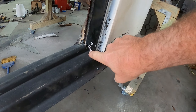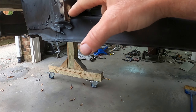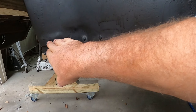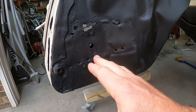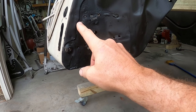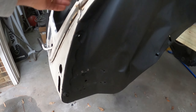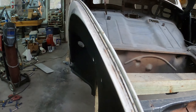I need to fabricate a little piece for the bottom of this pillar, and another piece for the very bottom outside of this pillar, cut out that rust, and clean this area up where I welded it in — I went ahead and painted the rust reformer without grinding first, so I need to clean that up. I also want to clean up the repair on the bumper bracket where the previous owner drilled holes and welded it in, but left extra holes, so I can repair those and keep water from getting into the front area.